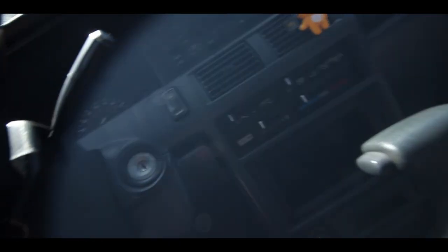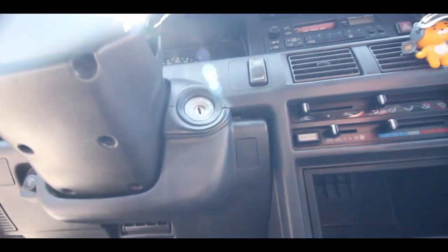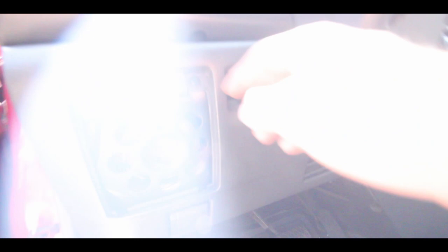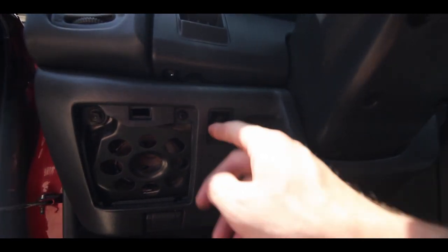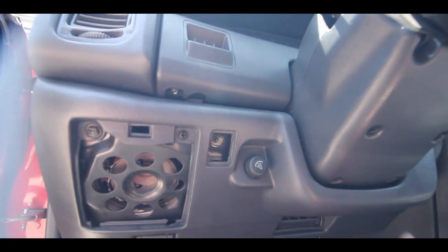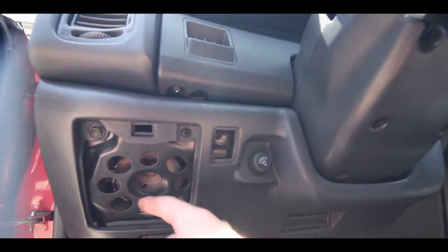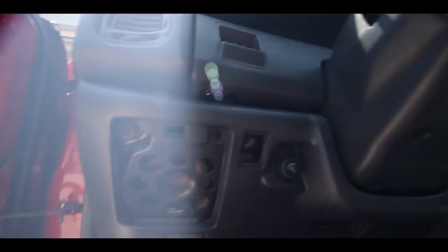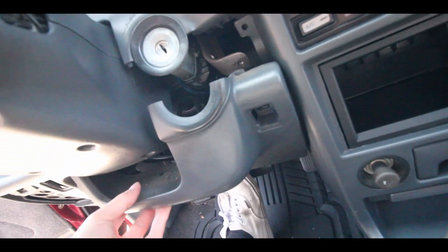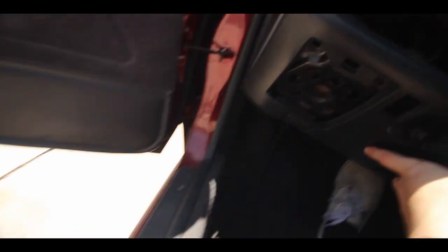There's gonna be a bolt screw right down here to take off, and another one on the other side. There are quite a few bolts — there's a couple of 10 mils that go at the bottom of this dash piece. You need to pop this little cover out right here, there's another 10 mil. I took this little speaker cover off and there's gonna be some more bolts because we need to take this off to get to the speaker and to reach the bolts that hold the center console part on. I pretty much got all these bolts out — there's one more on this I didn't see — and it literally just slides straight down.